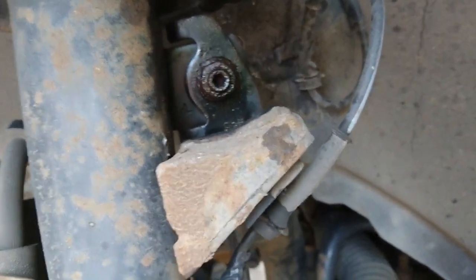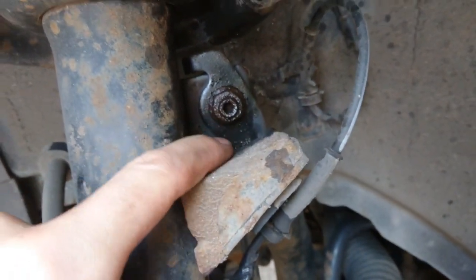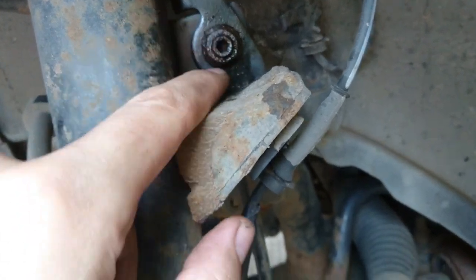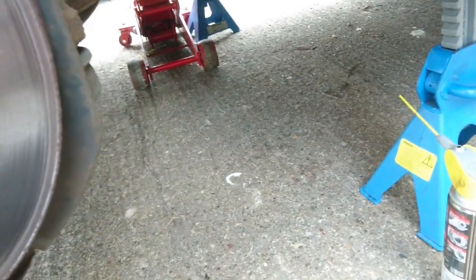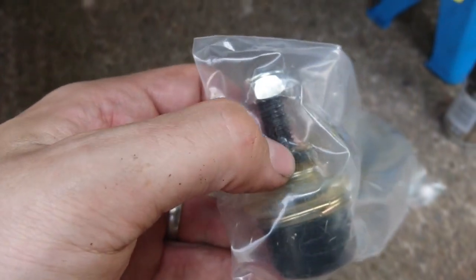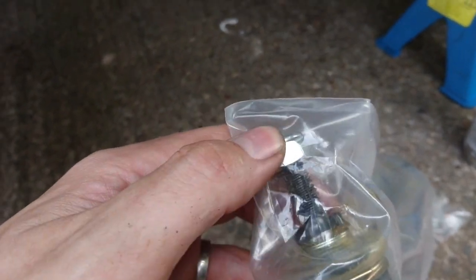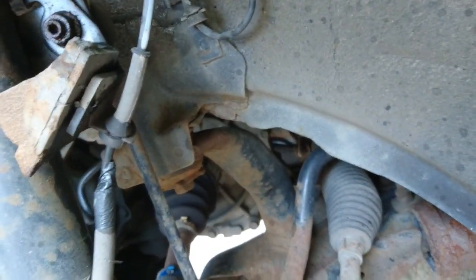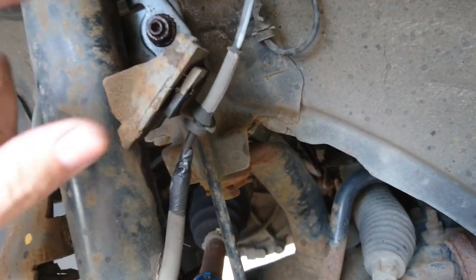They're pretty simple to swap — one nut on the bottom, one nut on the top. The idea is you put a 5mm allen key in the center and a 14mm spanner around the outside of the nut, and you crack it, then turn them against each other to get it off. What I do is crack it off with a bar first, and then once it starts to move and you get a bit free, put some anti-seize around it.